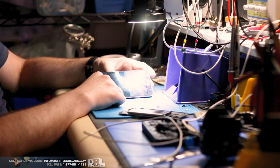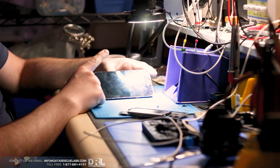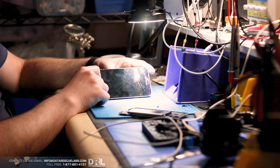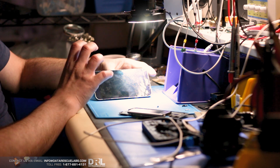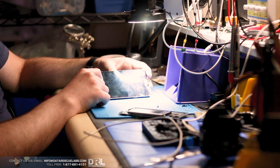We'll get the motherboard out and then we can either do chip-off or ISP — I'm going to try ISP. They want to preserve this phone; this is a forensic case, and the company that hired us wants this phone preserved. So that's what we're going to do.